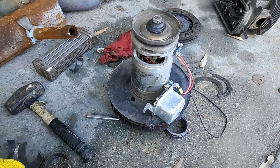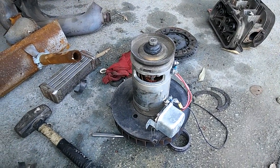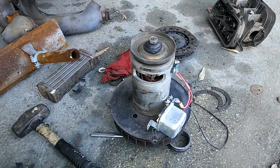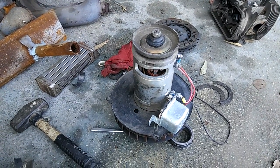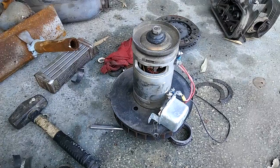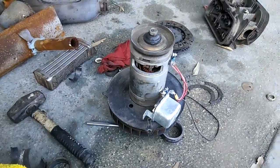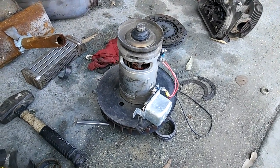If you're doing the conversion on a 40 horsepower, you'll have to replace the generator stand, the pulley, and the generator itself, or put in an alternator kit — and I'd highly suggest the alternator kit for a 40 horse. But if you have a 36 horsepower motor and want 12 volts, pretty much the only option is to do what I've described, and it will work. I've done it. Give that a shot, see if it works for you, and let me hear some feedback. Talk to you in the next video.